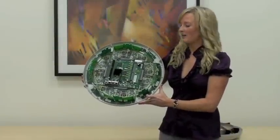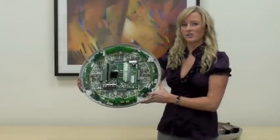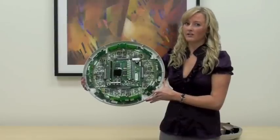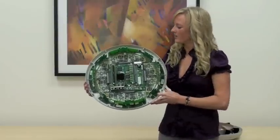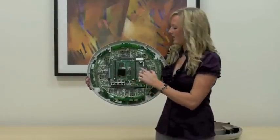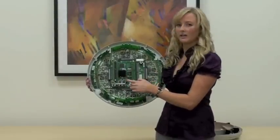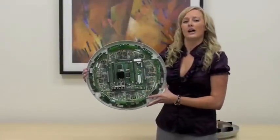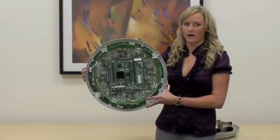Moving to the inside, all of our devices have a centralized controller with a 2 gigabit switch, so you're pushing the whole intelligence of your network out to the edge. All of them have a gig of system memory, a gig of packet memory, a gig compact flash, and a Power PC CPU. There's also an FPGA cluster that handles line-rate encryption and line-rate QoS.